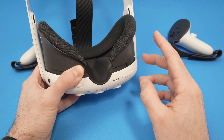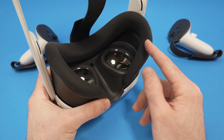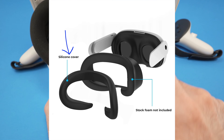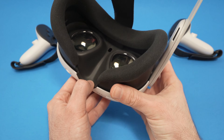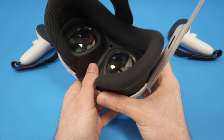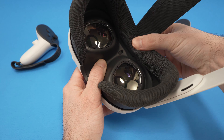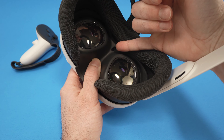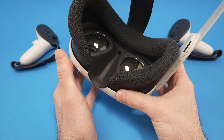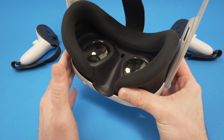If you're still having issues with your Quest 3, it could mean that your Quest 3 is actually turned on — it's just that the screen stays black. If you're using a silicone cover over the face mask, or any third-party accessories like a light blocker at the nose area or another mask, sometimes when you press them against your forehead, this part goes down and blocks the proximity sensor located right over here. If this sensor is blocked by something other than your face, the MetaQuest 3 will not recognize that your head is there and will not turn on the screen — therefore the screens will stay dark.